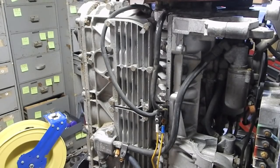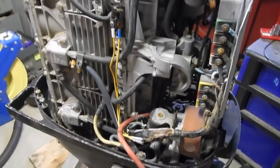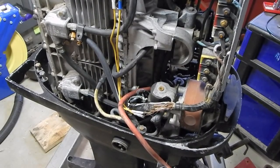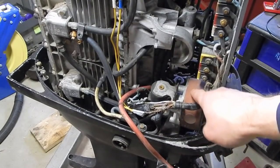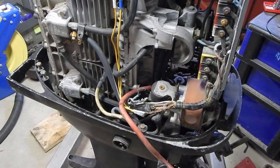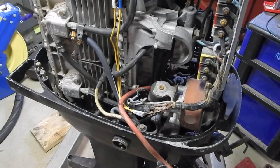That bolt is one of what looks to be nine bolts that hold this access cover on. I believe this is an inspection cover — when you take that cover off, you can look right into the cylinder and at the pistons. I might be wrong, and we might end up taking a peek later. But I don't like that — that shouldn't be loose, and it makes me think somebody's been in there. So I could put the starter in this thing, temporarily wire it up to get it to turn over and do a compression test. That's probably a good starting point for initial assessment. I don't want to go through all the trouble of reconstructing this wiring harness only to find out this thing's got a broken connecting rod or a piston with a hole through the top. Here's the starter solenoid right here — don't know if that's any good, but the wiring going to that is toast. And this is the unique ignition coil that they use on this thing.